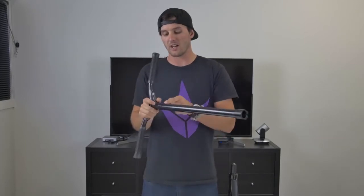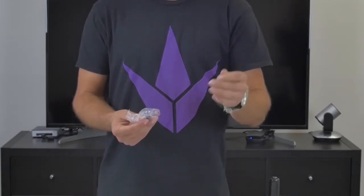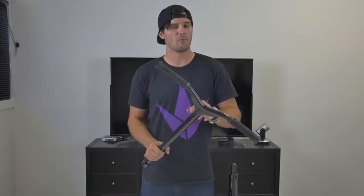Logo in the front, slit in the back. You might need to tap it down a little, but don't worry if it's not going all the way down — the bolt will ensure the bar is nice and tight. Inside this small bag is one 6 millimeter bolt, two small washers, and a rubber pad. When putting the bolt in, make sure the washers are installed correctly: the one with a cut in it goes on top, and the washer with a small rounded bottom goes on the bottom. Slide the bolt through the top hole and let it fall in, then grab your 6 millimeter allen wrench and turn it clockwise. Once the bolt is all the way down, give it one more quarter turn to make sure it's snug and everything is flush. Install the rubber cap on top — your bar is set.